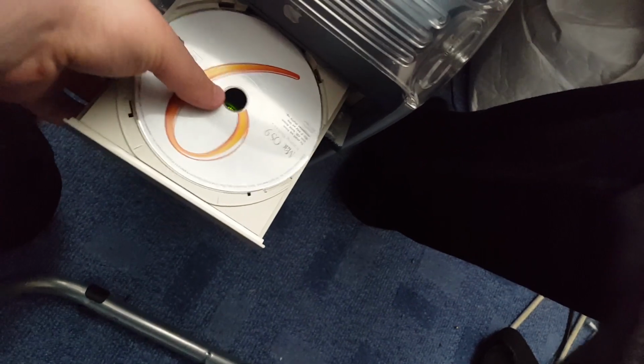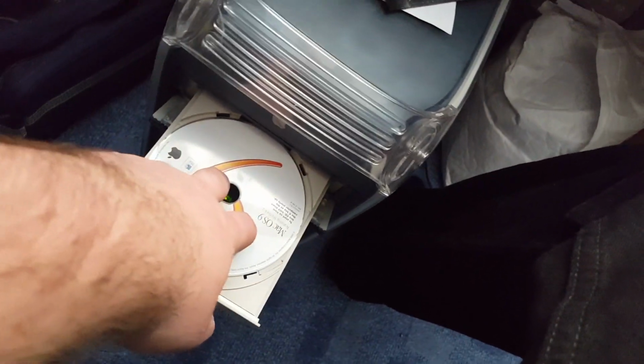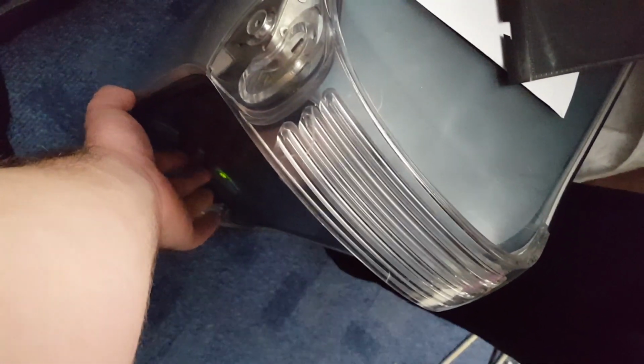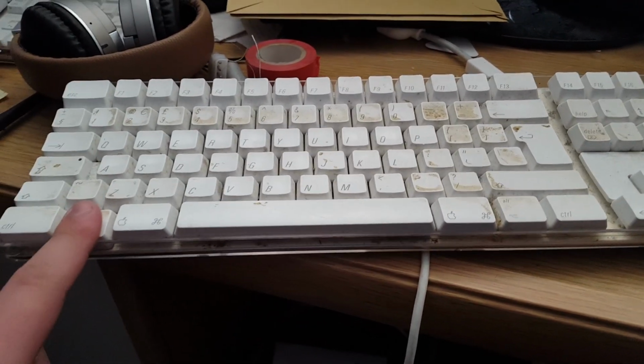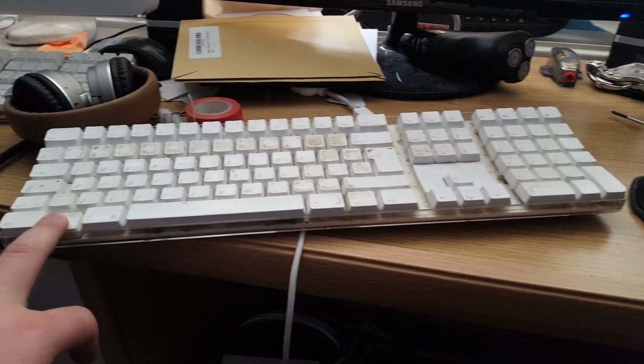Okay, so the machine is back in place. I'm going to switch him on. I'm going to get the Mac OS 9 install disk out of its sleeve. We'll press the button to pop the disk drive out, because this is pretty much the last PowerMac to have that, and it just swallowed the disk without me even doing anything. So okay, let's restart. Alt. I know it's normally C, but I prefer to do the Alt, so I can see that it's actually recognised the disk.